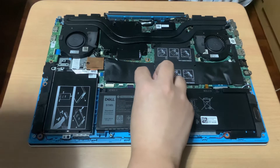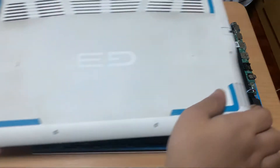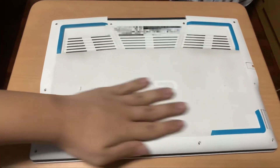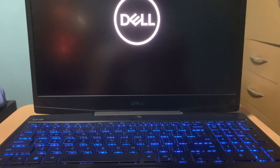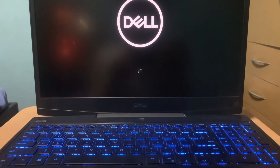Finally, plug the fans and the battery to the main board. Before putting back the back panel, I'll try to turn it on and test if it boots up. I've tested the laptop off camera, so now I'll install the back panel and turn on the laptop. Thank you for watching — don't forget to like the video and subscribe to my channel so you won't miss my future videos.